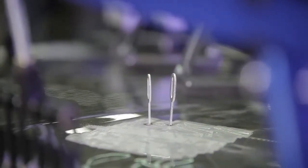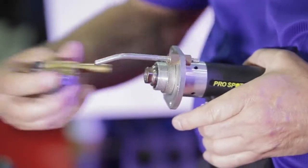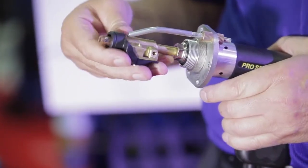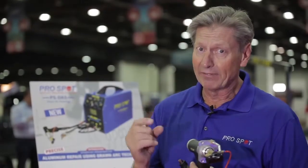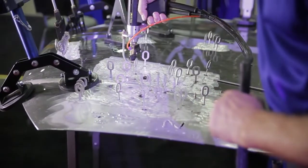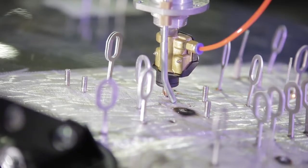It's also very good for using studs. We can use a different adapter that we insert here and then use threaded studs. Threaded studs are going to be key for aluminum repairs. We have more and more aluminum vehicles on the market, and replacement parts may not have the studs, so you're going to see a lot more aluminum stud welding in the collision repair environment as well.